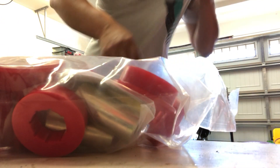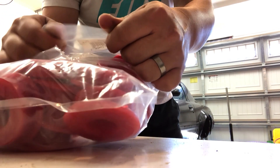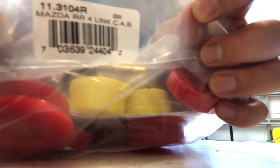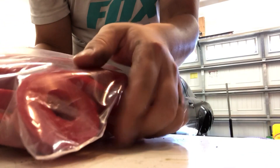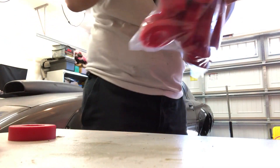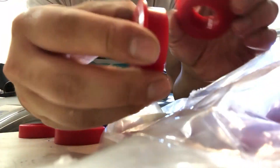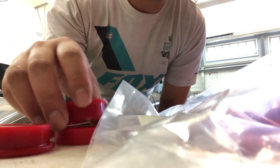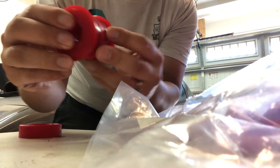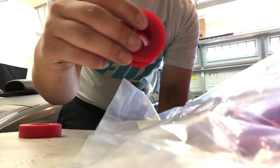I've got a full kit here — this is the rear suspension, part number 11-3104R. You've got these harder inner pieces, some softer outers, sleeves, and some lube as well. The inner piece is a harder durometer than the outer pieces. What I believe they're trying to do is make it so you still have some compliance on the outer bushings, but the inner one is going to help locate the arm back to front better.